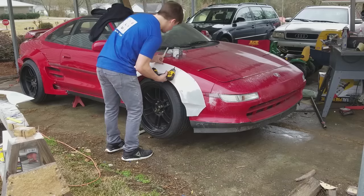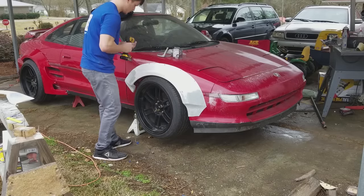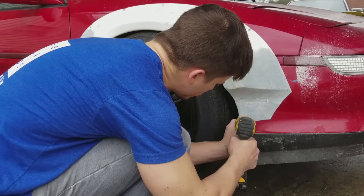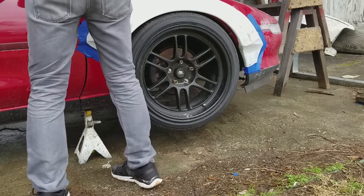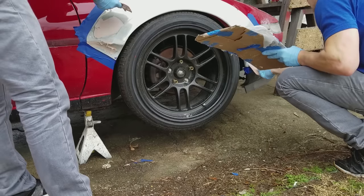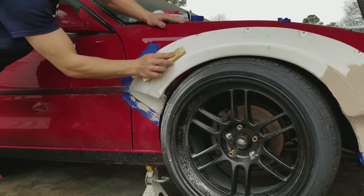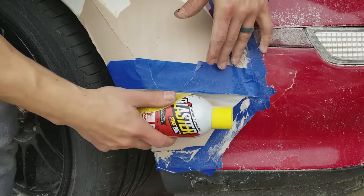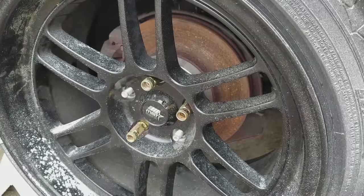The fender's back on the car for this next step. I needed to apply some Bondo to fill in a little bit further, and I wanted the fenders to be in the shape they'd be in when I put the Bondo on. Bondo is not super flexible and not as strong as the fiberglass filler, so I wanted it applied while on the car. I covered the entire thing with Bondo — everything I had put fiberglass filler and fiberglass on. Most of it gets sanded off so it's not like a total Bondo bucket; it's really just there to fill in gaps and help shape and make edges a little tighter and cleaner. I also used more blue tape to make sure my lines were straight — after the first sanding my lines had some waves, so I used tape to keep them straight while sanding.